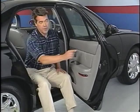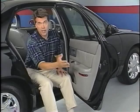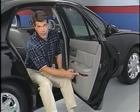Water from this leak would run down through the door pad and come out along here and run onto the floor. The leak would seem like a water deflector leak, but those simply do not occur on Regal and Century due to door trim design and the water management system in the rear doors. Also, no weather strip leaks have occurred on these cars. One sure sign of this leak is water coming from the lamp housing in the door trim pad right here.